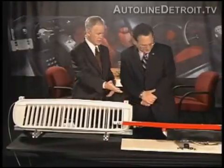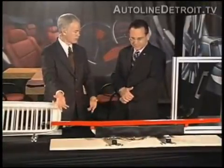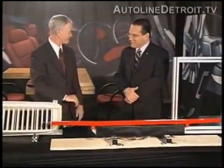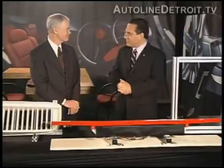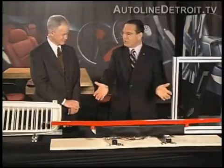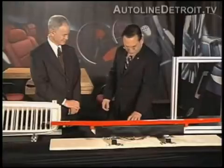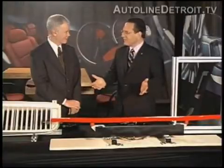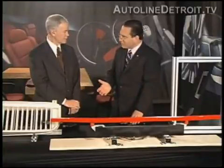Let's move down here. The red one — what we're looking at is the rear spoiler on the car. There's a desire both for styling and for control of fuel economy to have it deploy dynamically. No motor involved. There are several of these that do move in the industry today using complex motor mechanisms. This is using that simple wire we showed before — fast deploy, and fast undeploy when we're ready for that.